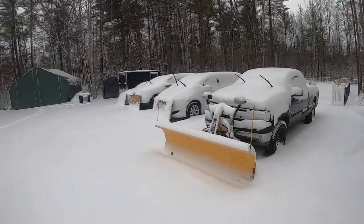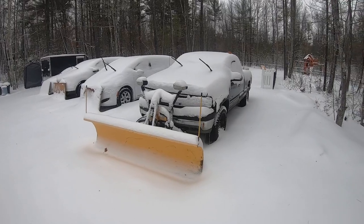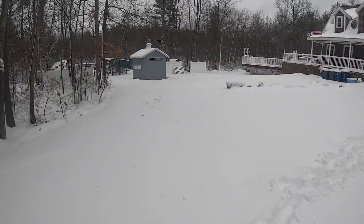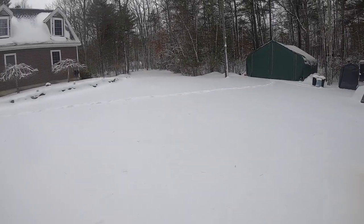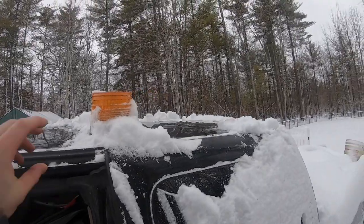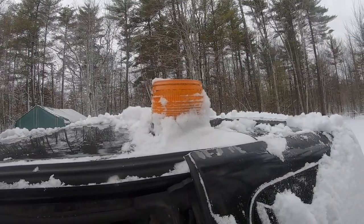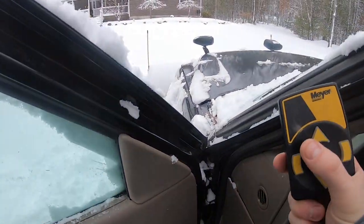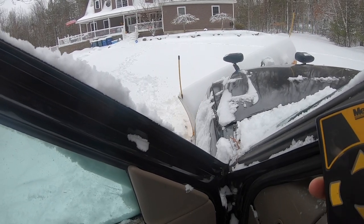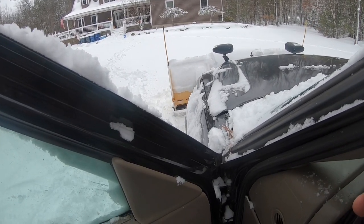Welcome back to the homestead. As you can see, we have a pretty huge driveway here. With our plow truck we're going to brush this off, get it started. I'm going to throw you guys on the hood, we'll do a quick time lapse, and I'll show you how to drive a plow truck and give you some tips. First thing — make sure you have a beacon light. You want to be seen; plowing is a very busy activity, so invest in a beacon light. Second, you have a plow controller: up, down, left, right — really simple. Hit up, plow goes up; left, plow goes left; right, plow goes right; down is down.